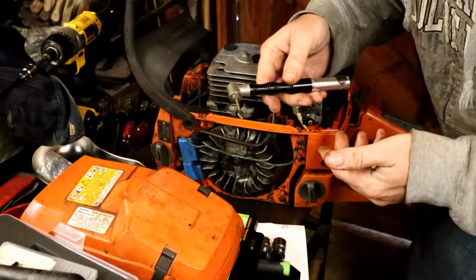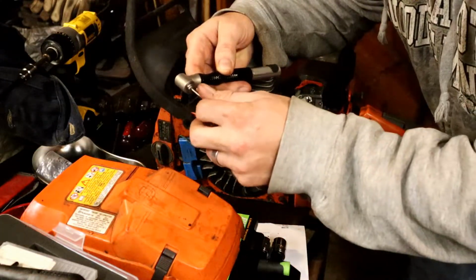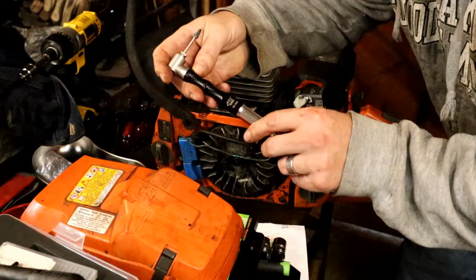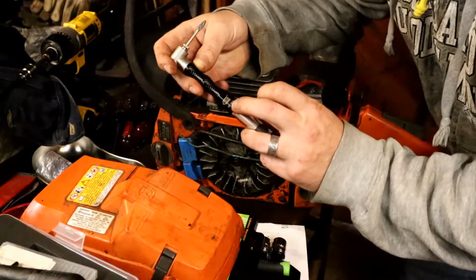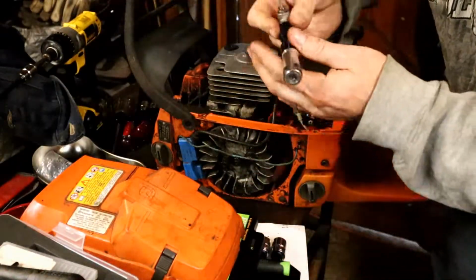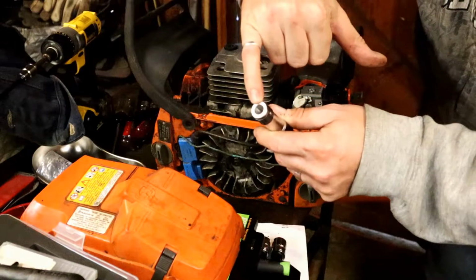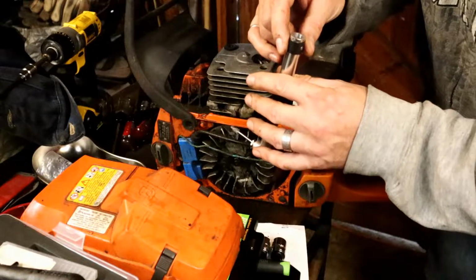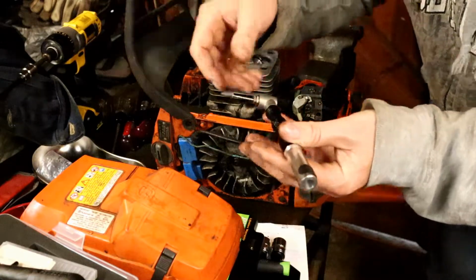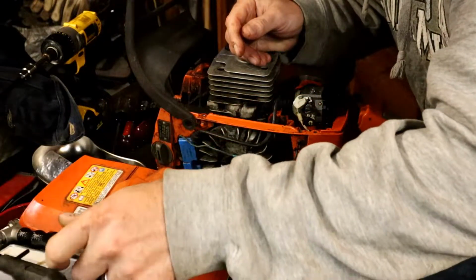But while we're just talking about new tools, this one is actually really important to have, that 90-degree head on it. I found this one on a site called DH Gate. So this is THS TS90D. There is one catch with this one. Stock, the Foredom sleeve won't fit inside of here, so you're going to have to take it to your lathe or some other way. I had to take about 4/1000ths out of it, 2/1000ths a side, to get that to slide in there where this is actually usable. So keep that in mind if you're looking at getting that brand.